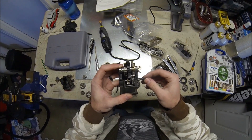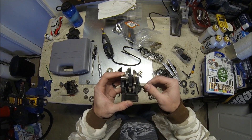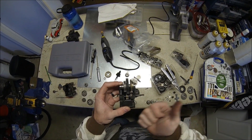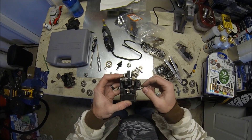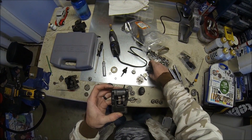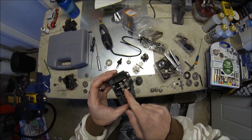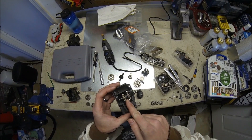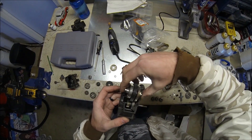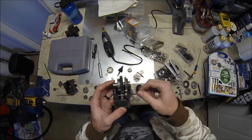Here we have them locked up — I haven't shortened them yet. As you can see, I've got to bring the 18-tooth in. To do that, you need to shave those pins down pretty far. See those spacers in there? You're basically going to shave or cut it down to where you're just using that small little spacer, and then you will have enough room where the gear sits on all of it.